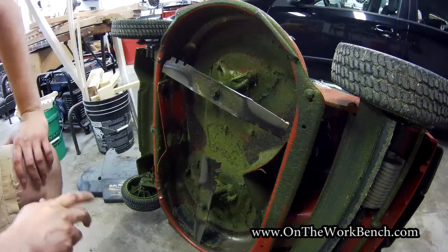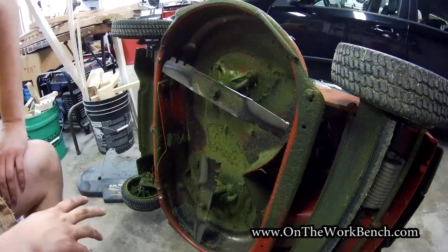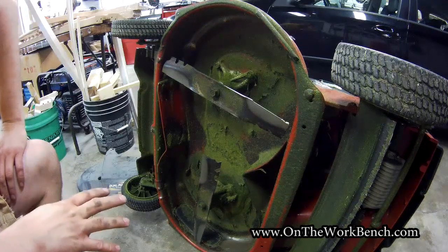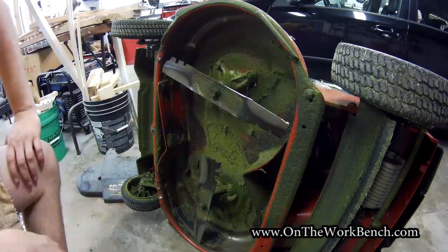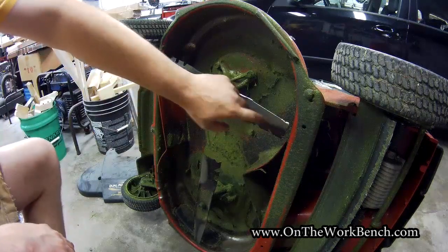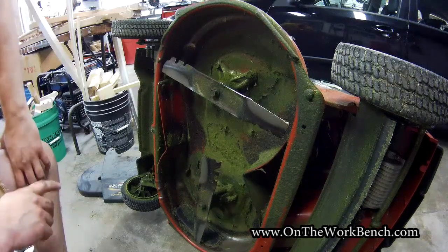You can see there's definitely a strike from where the blade likely struck the other blade when the synchronous belt broke. If you're replacing the synchronous belt because of a break, I would highly advise replacing these blades as well — just to make sure there's no fatigue or metal issues from that strike, given the speed of mower blades. It's better to be safe than sorry. If you're just replacing the belt as routine maintenance and not because of a break, you can probably skip that. I'll be replacing these blades too, though I'll cover that in a separate future video.